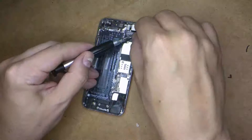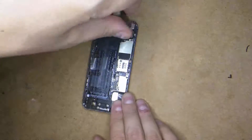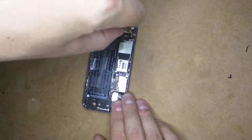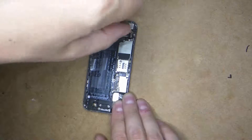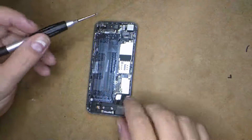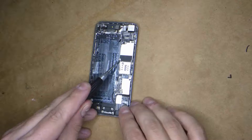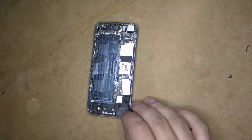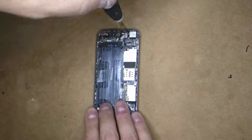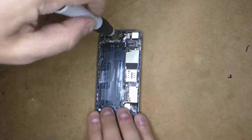And the third one is at the top. This one's a bit tricky because it doesn't come off easy as it's not magnetic, so you'll probably have to use tweezers or your fingers to pull it off as it won't stick to the screwdriver. Now with the Phillips head screwdriver you need to take out the remaining screws. Essentially what we're doing here is removing the logic board.